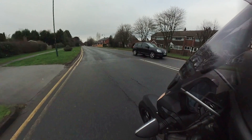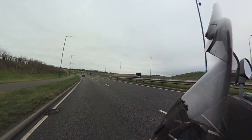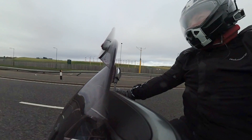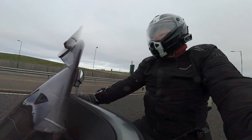The standard DigiNow charging bricks are 3.3 kilowatts and they take up about a third of the space taken up by the stock charger. So for two extra kilowatts you're taking up a third of the space. There's also an option to buy a 10 kilowatt unit — one unit to fit in the same space occupied by the standard stock charger, albeit with a slightly deeper supercharger belly pan, but it fits effectively in the same space. 10 kilowatts charging instead of 1.3 kilowatts — that's quite something.